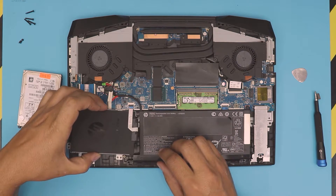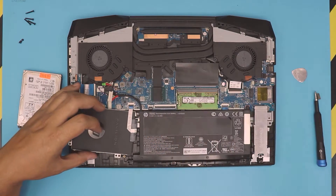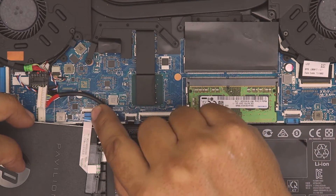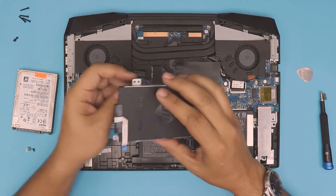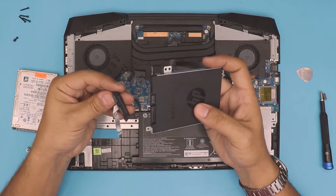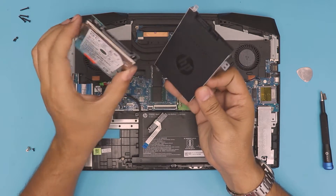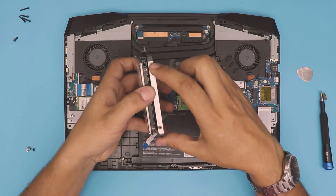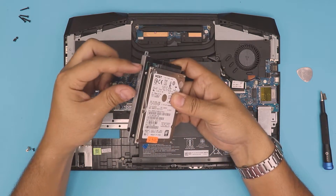Pull the tray up — you just have to release the small tab that goes under the plastic. Before that, disconnect the ribbon cable by lifting up the black hinge lock 90 degrees upward and pulling the cable out. Now you have the empty plastic tray. Remove the little bit of adhesive tape and pull the adapter out. Then remove the four bracket screws — two on each side — take off the metal bracket, and attach it onto your new drive in the same positions on both sides.